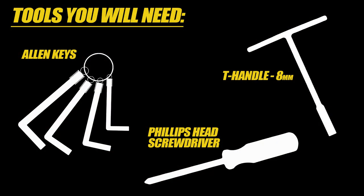Now that we're here in the shop with our RMZ250, we're going to start by draining the coolant before we get into getting the radiator off. Tools-wise, this is a pretty simple process. You mostly just need an eight millimeter T-handle to get the plastic and the radiator off, a drain bolt, a Phillips screwdriver for the radiator hose clamps, and maybe an Allen key for the drain bolt, but for the most part it should be an eight millimeter.